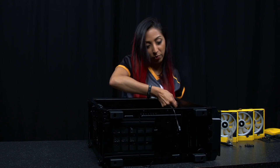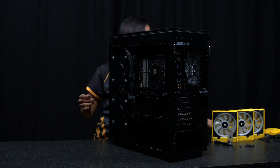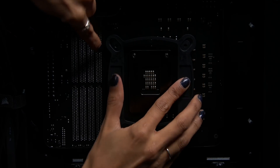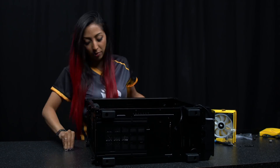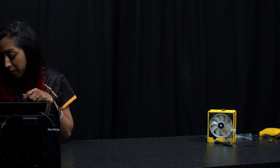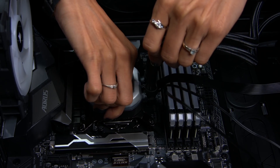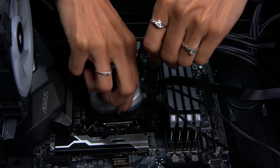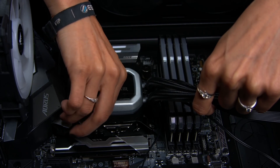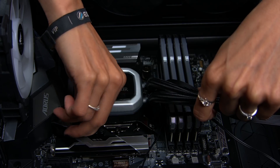Place the plate back into the case and secure with the screws that were removed. Slot the cooler bracket into the back of the motherboard through the four holes around the CPU, and screw this into place at the front via the double-sided screws. Remove the plastic covering the thermal paste on the cooler, carefully line up the cooler with the four double-sided screws, then secure with the thumb screws — making sure to go to opposite corners rather than a clockwise or anti-clockwise pattern. This will ensure the thermal paste is spread across the CPU evenly.